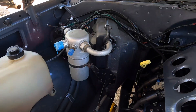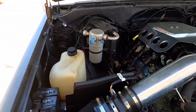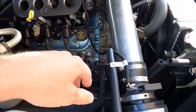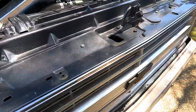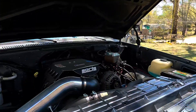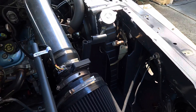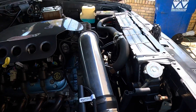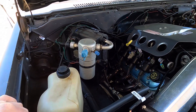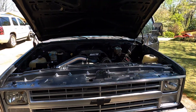Hopefully the fittings are correct because I wasn't totally sure. Brand new blower motor — it's all going back in this bad boy for some hopefully ice-cold air. I've got to break the box apart, get all that stuff changed out, and I've got some fittings to go on the compressor to extend the hoses out. The only thing I wasn't able to get new this time is the condenser — it'll be the original condenser. Hopefully there's no issues, but if there is they're completely back-ordered. Plan is to go everything brand new on the AC.